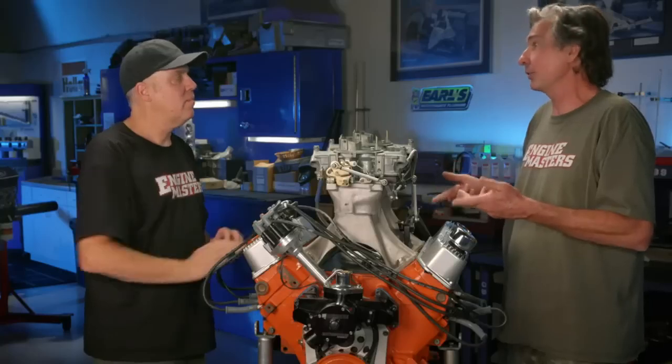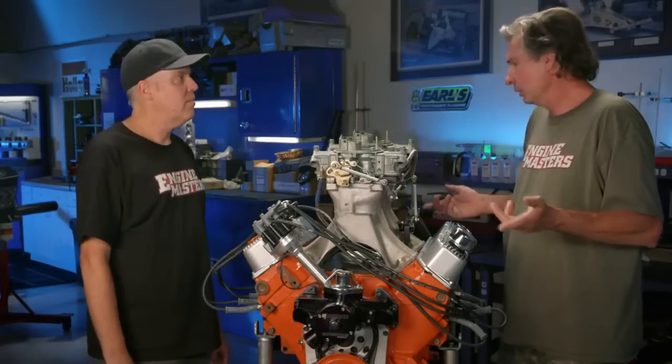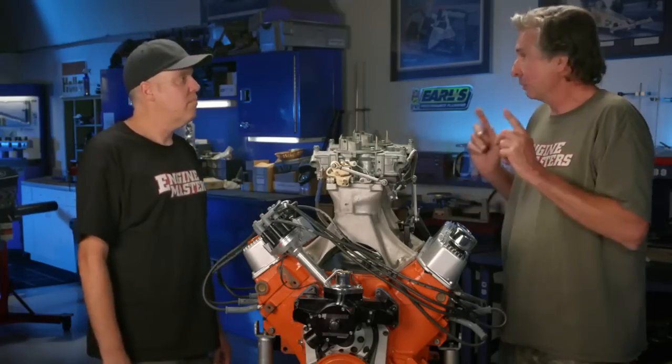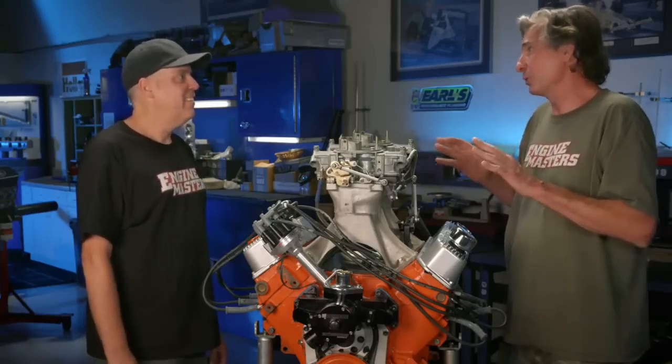Another validation besides the horsepower: when I first put this together, I used a Comp roller cam, which is quite similar to what we tested today, and I picked 107. Oh, did you? Yeah. And it made almost the same power as our 106. So there you go.